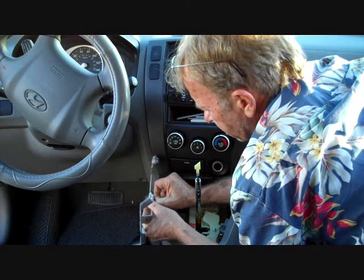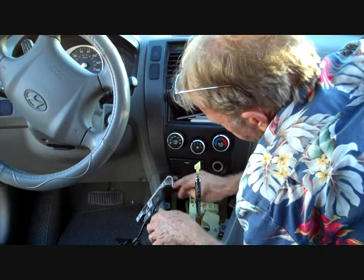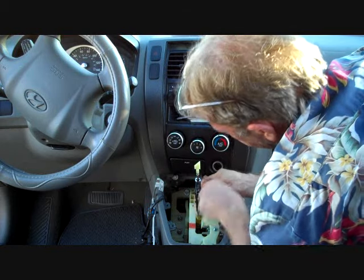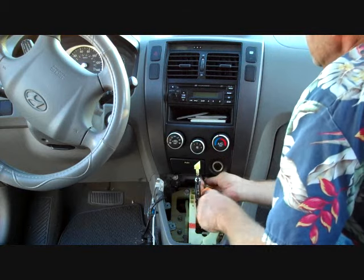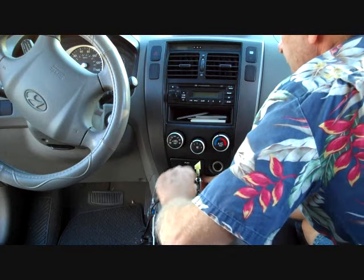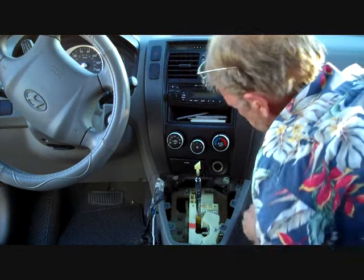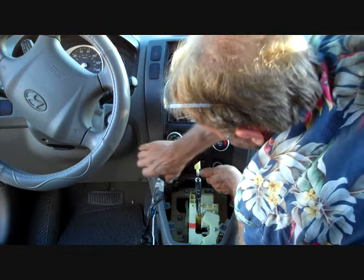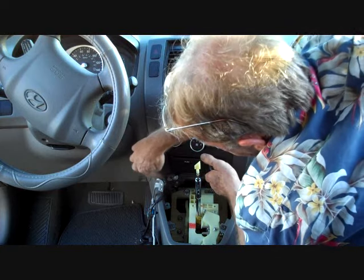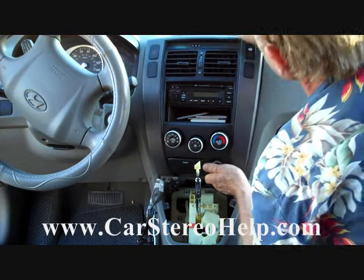This will allow us to pull the frame off to the side. It is attached — you can take needle-nose pliers and squeeze the tabs together on this clip to force it back through the front if you want to remove it. With this bracket loosened from the front trim panel that goes around the steering wheel, there is one more remaining screw at the bottom in the center of this front panel. Remove it, then clear the clip at the bottom from the side panel and pull this entire front panel forward — it comes loose.